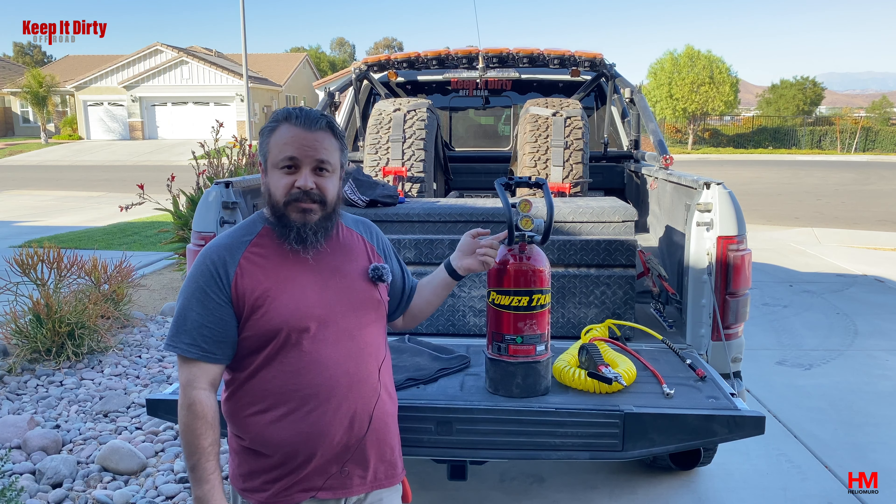Compressor's connected in first. Make sure you open it upright. We're going to 40 psi. We started off at about 20 psi on both tires and we're going up to 40, which is what we normally run. I know some of you guys are thinking that's a little high, but the Toyo RTs look deflated at 38 psi. So we go a little bit higher just so they look more pumped up, and it helps with the fuel economy.